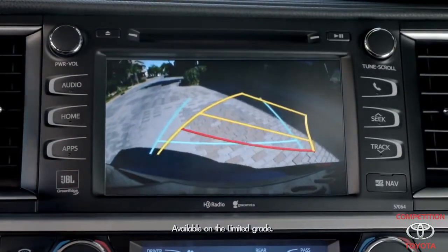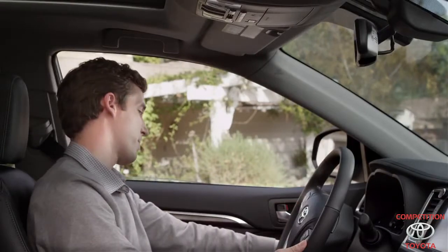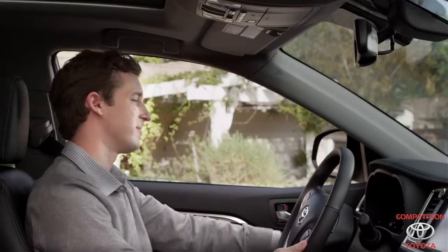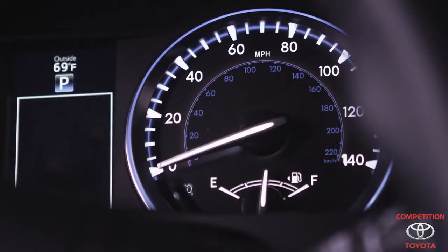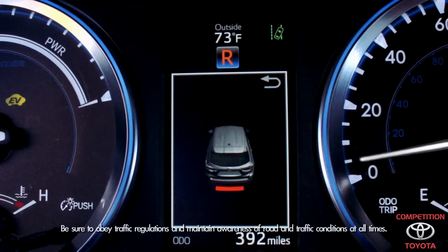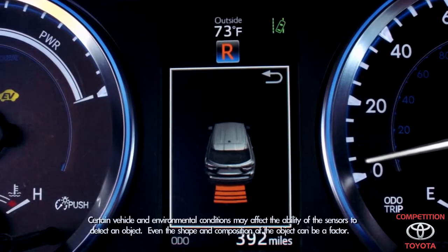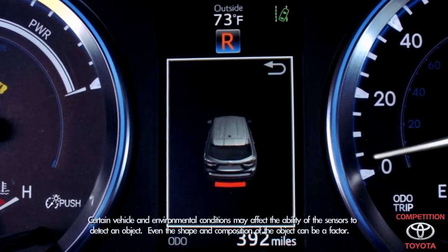So you know the location and distance from obstacles behind the car. To use the rear parking sonar, the driver needs to turn it on by pressing the button just to the left of the steering column. You'll also see confirmation that the system has been engaged by a light with the sonar logo on the dash. When you shift into reverse and when your speed is less than six miles an hour, the sonar graphic will appear in the multi-information display. The speed of the warning tone and the color of the graphic in the multi-informational display will give you an idea of how close you are to an object or obstacle.